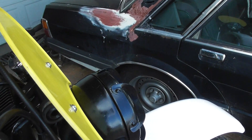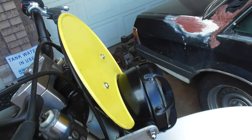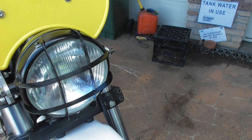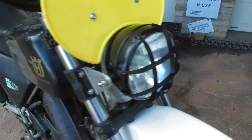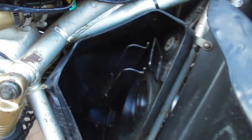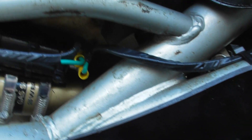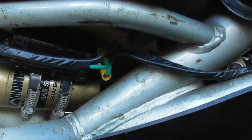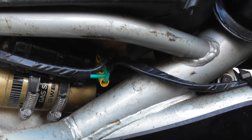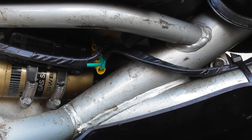There's a regulator/rectifier full-wave type thing that sits in under the clamps on its own bracket — minimalistic type setup. I've actually put a capacitor under the seat and a diode, so when I do get a stator that actually works, I will run LED lights with the capacitor to stop any flicker. But it's a case of fussing around with the stator and that's not going to happen today.